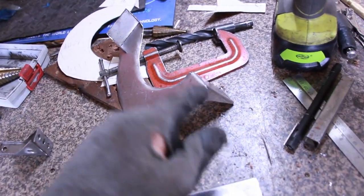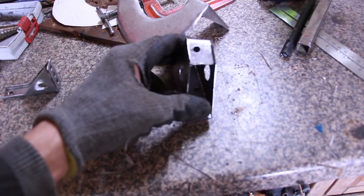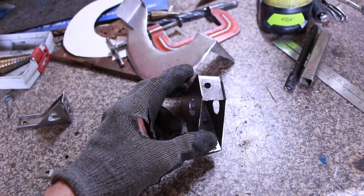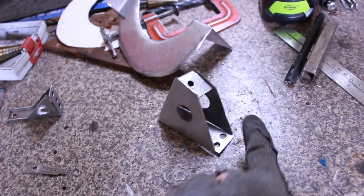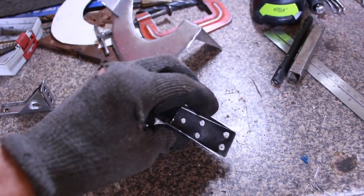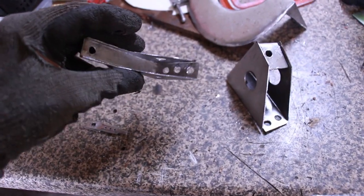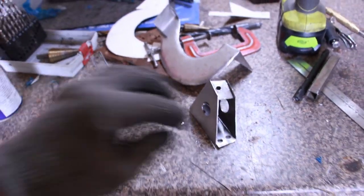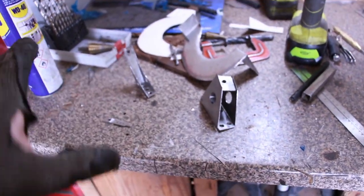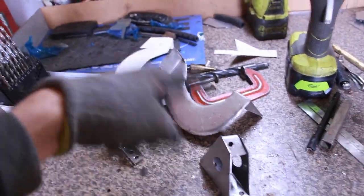So next job is to weld these up, and then we're going to get this in position. We're going to weld an M6 nut on the back of that. We're going to bolt it to the actual piece on the car, and then adjust this, just tweak it to the final adjustment before we put some welds on. Weld that up, put it in the car, and then we can weld the five tacks in onto the car. Same with this really, we'll just tack that in, see if it fits okay before we weld it into the car. So that's the next job, weld those up in their positions, linish them, and then they'll be welded onto the bulkheads. Well, that one won't, but that'll have holes then drilled for the bolts.